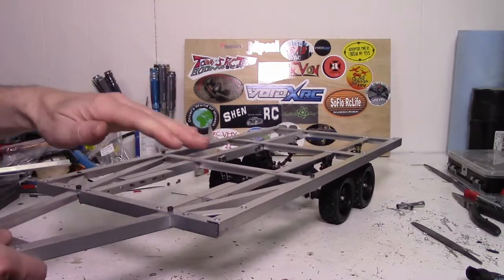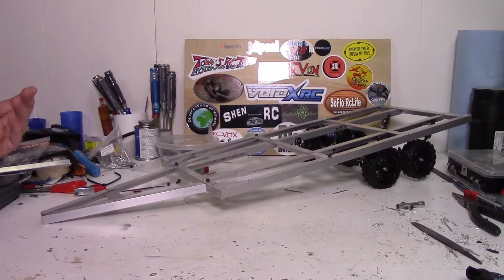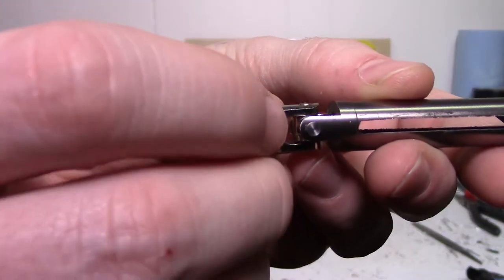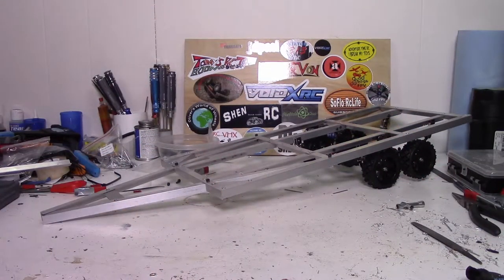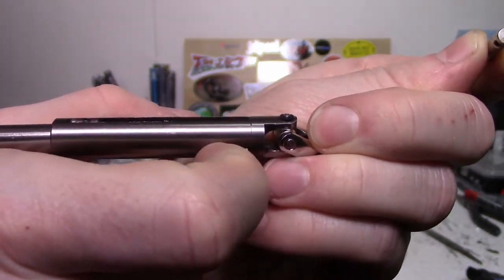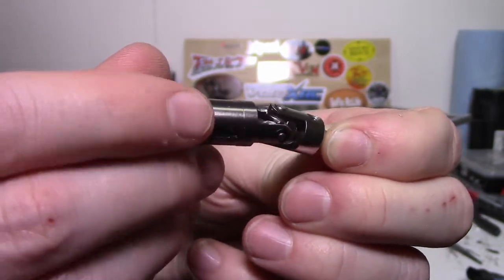There are still some other things that need to get done other than the bed for this trailer. I need to get a hitch on here. I wasn't really sure what to do — I didn't want to buy anything, but I thought maybe I could make something similar to a poly block coupler, which is something I've seen Australians use on their trailers. It's sort of similar to a u-joint but not really, because it's offset. My plan is to just have this coming out of the bumper, cut it right about there, and that would just be my coupler — back up to the vehicle with the trailer and you get nice degrees of movement.